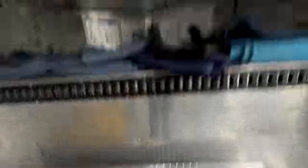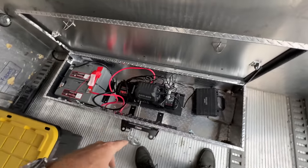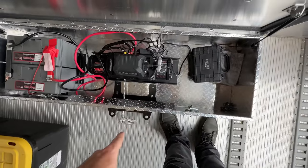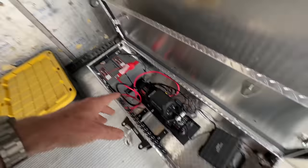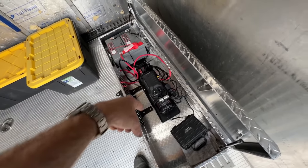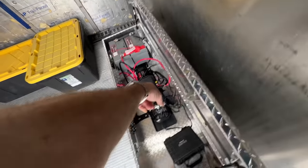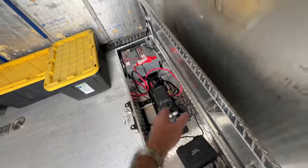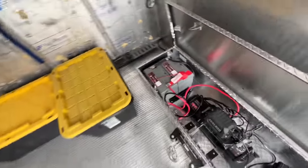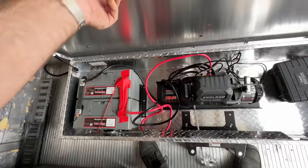The hitch works. This thing is leaking up here - we're getting water. It's been raining here, which never happens in Vegas. But I took that extra fairlead mount and put it on the back side of this because I needed this to be sturdy. There's water leaking - it's not supposed to rain, we live in the desert. Anyway, this is super mounted - this goes through the frame. This toolbox is in there pretty tight, and it serves a dual purpose in that the top of the winch is basically touching the lid here. I put some tape there as just a little extra protection.